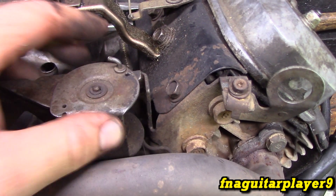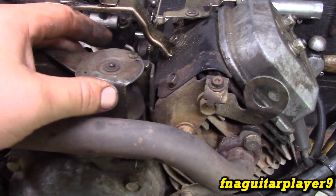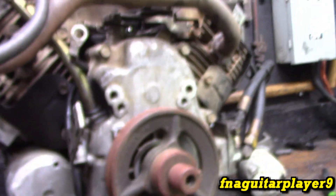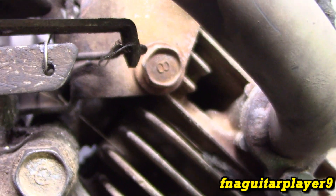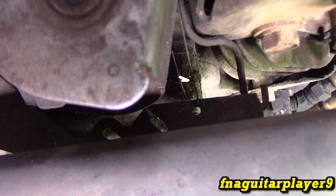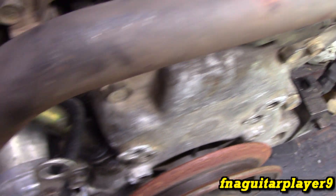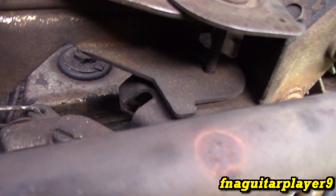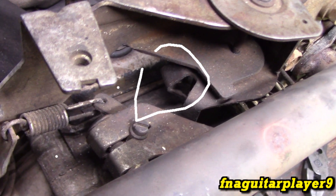Usually the best way to set it up is hook the cable in here, leave it loose, set this to full throttle, and just take the cable tight so it's set to full throttle - that way you know you're going to get maximum full throttle and it should release to idle. Your actual governor spring is that big spring right there - it ties in on the governor arm in that second slot, then runs over and connects on that tab right there.